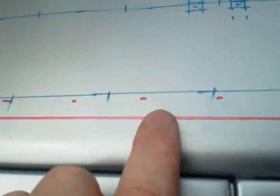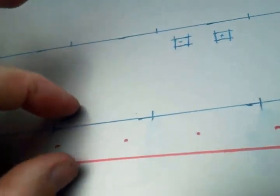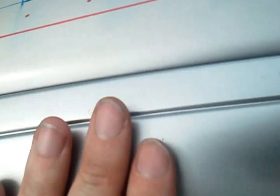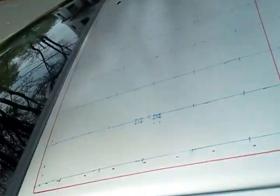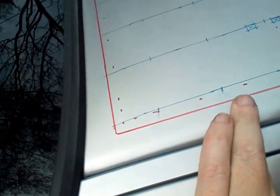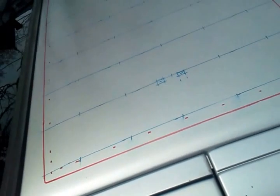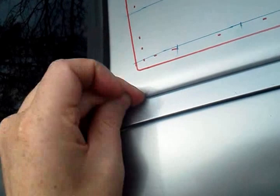Since that tape is 19.1 millimeters wide, I'm going to be leaving 8 millimeters at the border of the trim — I grind that down — so that when I put the tape down it will cover that but leave that paint intact. The panels adhere strongly to the metal, not quite as strongly to the paint, but the paint stays under it, keeping it aesthetic and clean. I also kept myself a little away from the border of the car so I could silicone and make a little ramp and slope for the edges — that's the other reason the panels aren't turned the other way, because that would bring them all the way out to the edge and I wouldn't have that little buffer.